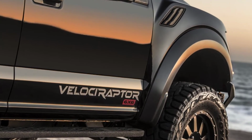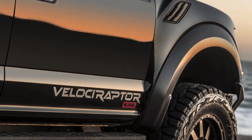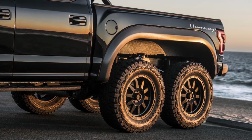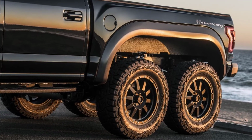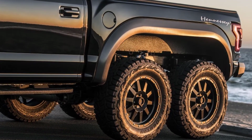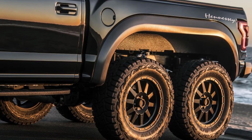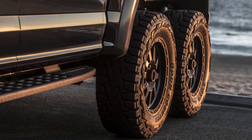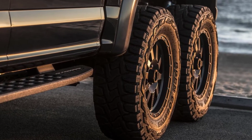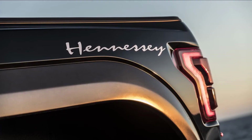The rear differential can still be locked via a dashboard button, but now passes through an extra gearset that's been sourced from a third-party supplier Hennessey prefers not to mention by name. Huskier tires add 1.5 inches of height, and along with the lifted suspension the overall altitude gain measures 8 inches. The VelociRaptor's expanded proportions add about 1,000 pounds to the donor car's 5,697 pounds curb weight.